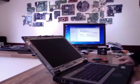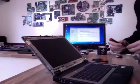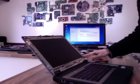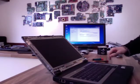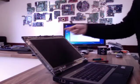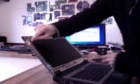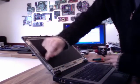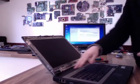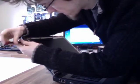Right, now there's 2 ways of doing this. Sometimes you need to take out all this framework that the panel is attached to. Sometimes you don't. It's just a matter of undoing screws until it comes off. You've just got to be careful to support whatever you take off so nothing falls. But in this case, most of the time, there's screws going down the side of the panel, and by removing those you can just take the panel straight out without having to undo any of the other framework. So I'm just going to take these screws out.